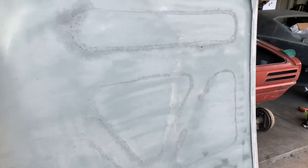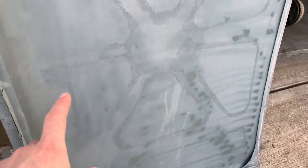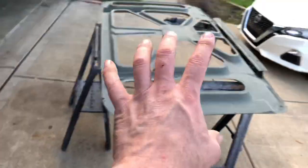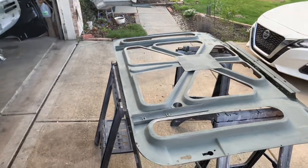The reason I don't want to do large patch panels here is I don't want to warp this panel whatsoever — it's just too big and flat, and beyond my skill set with what I have at home to get it straight back out if I started welding patch panels in. But I feel pretty confident I can make a piece go in this smaller area. I'm going to lay this skin back on top while I'm working on it to give it some structure, because this thing just flops around.